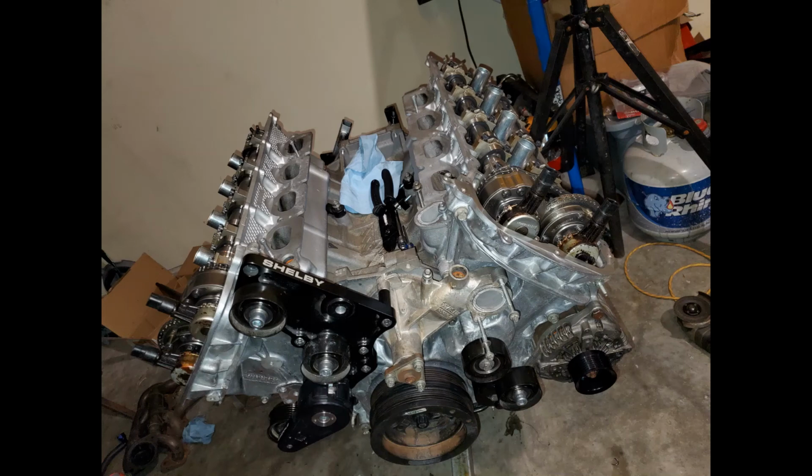And then I used the pulley on the alternator. It's a bigger overdrive pulley for the alternator so that it lives, I guess, because it shifts at 7,000, maybe 8,000 RPMs. You'll kill the alternator real quick on that.